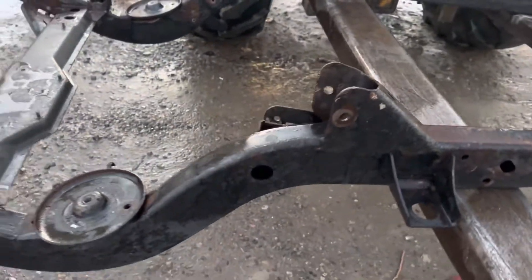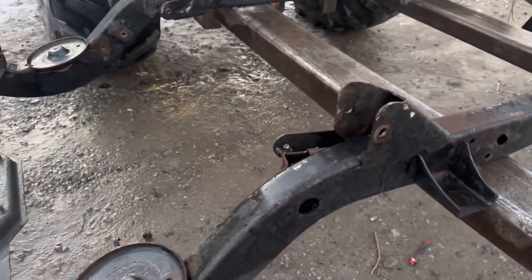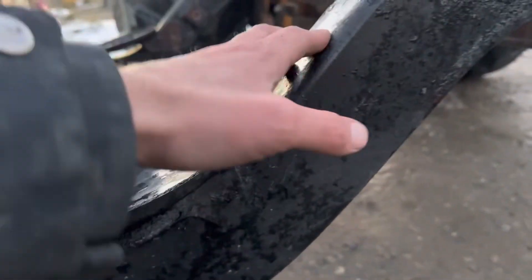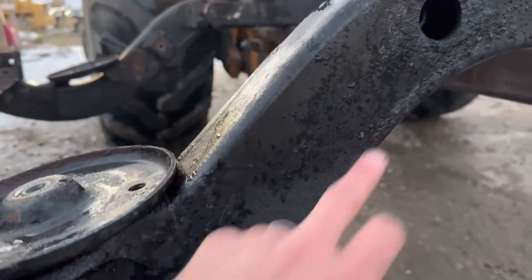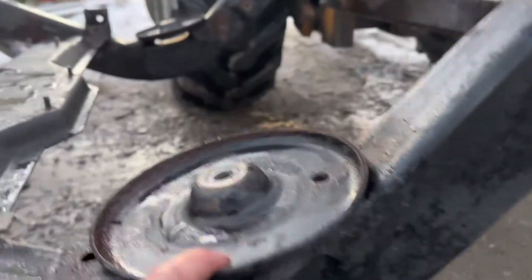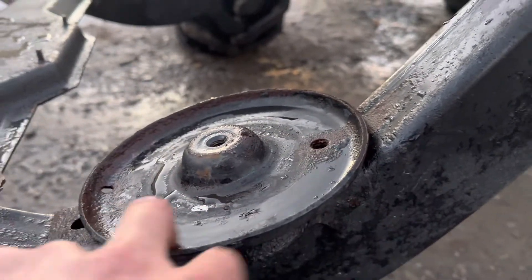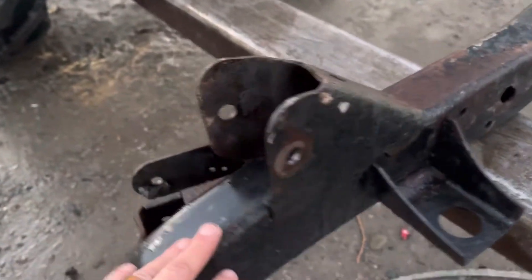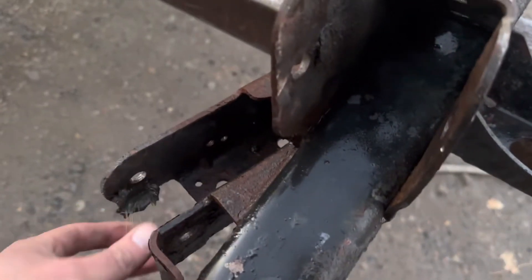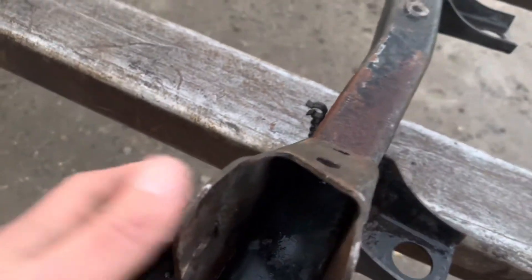My fingers are almost blue right now. So this is the famous area — if you're on the East Coast, this is where you're going to see most of your rust. This is upside down, so remember that. But this area loves to trap stuff in. They didn't do a great job making clean-outs for these frames. Preventative maintenance and washing all the time will help prevent this. But you can see all black factory paint. Look at the coil box — it's super clean. You've got a little bit of oxidized metal on these guys here, but nothing that's flaking up or deteriorating.